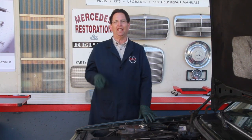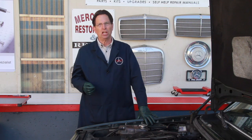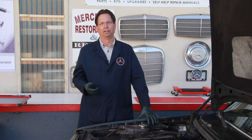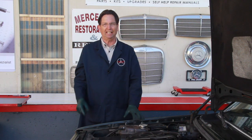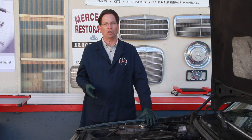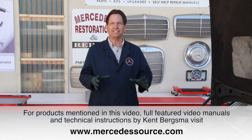There's one thing I forgot to mention that the owner had to do to keep driving this car. You won't be able to do this with all cars that develop this kind of problem because it depends on how big the leak is. If you have a big head gasket leak or a large crack in the cylinder head, the high compression of a diesel engine will force so much pressure into your cooling system that it'll start blowing the cap. For some reason he was able to just drill a very small hole in the top of the coolant reservoir tank — that allowed enough excess pressure to escape without losing a lot of coolant. In part one of the video workshop series, I'll show you how we're going to hook up a tester to test the pressure inside the cooling system to see how much and how fast it leaks down.